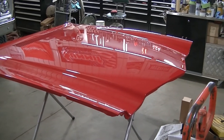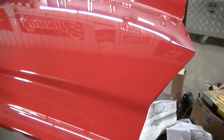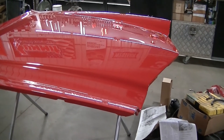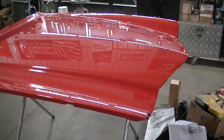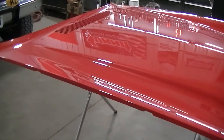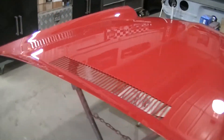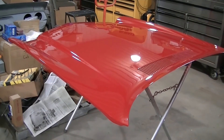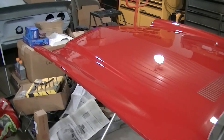Not building a perfect show car anyway. So I'm going to have to get my wet sander out, let this cure up for a little while, then wet sand it and probably go after some of the worst debris in the hood and do a little buff job. I'm not going to go after it like a show car and try to get the paint completely flat, because that's not what this car is — it's not what it's going to be.